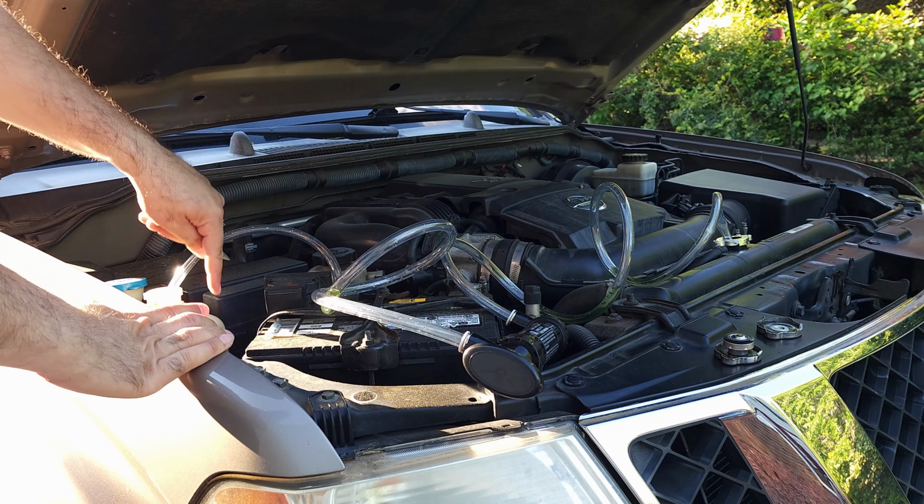So guys, it reached operating temperature, and the air blowing was hot earlier. And one of the steps that needs to be done according to the Haynes manual is to rev the engine a few times. So that's what I'm gonna do, and I did this a few times already. So I'm just revving it for about 10 seconds, and then I'll let it go down, and the hot air is back. So that's the reason for the revving.